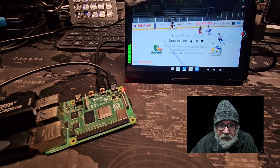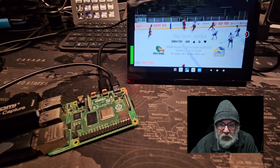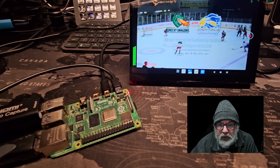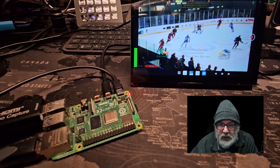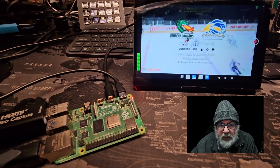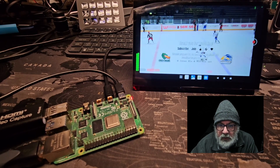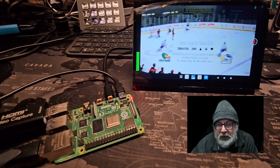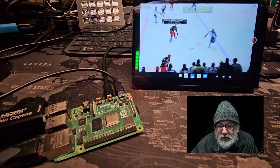I've got a Raspberry Pi 4 connected to a 7-inch LCD with HDMI and USB for touch input. I loaded the Android distribution as described by Don in his video, and then I'll sideload the Larix APK just to get it going. I'm now feeding through a very cheap AliExpress USB HDMI capture the last recording I've got from one of the games, and I'm able to HTML overlay the scoreboard and other information. I'm sending this out to my Restreamer server just for testing. As you can see, it seems to be working.